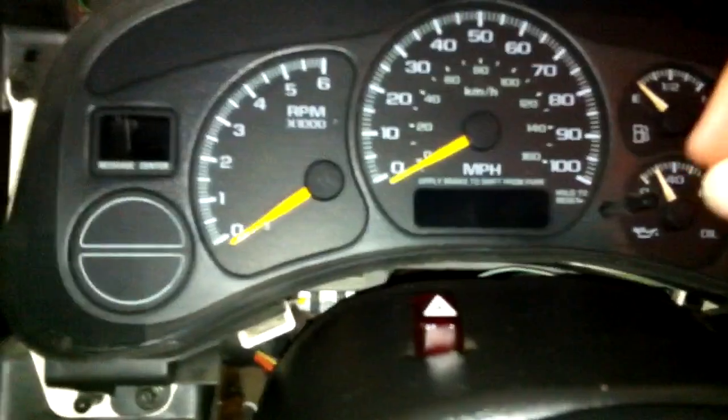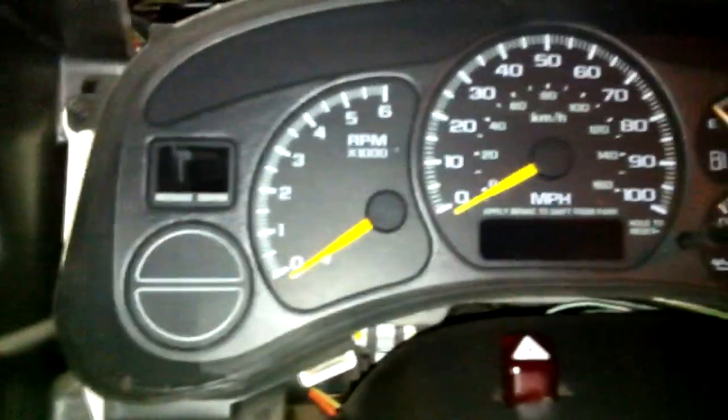So I went and checked the fuse. It's a 10 amp fuse located in here. So I put the spare in. What I noticed was when I took the fuse out, I put the ignition on and both of these displays run off the same fuse. When I pulled the fuse out, neither one worked. And y'all just saw that when the fuse is in, this one works. So it's not the fuse.